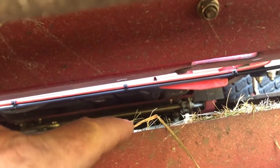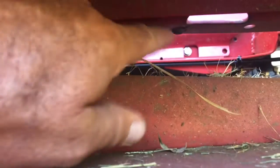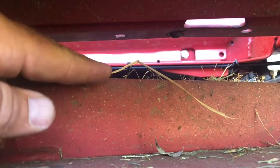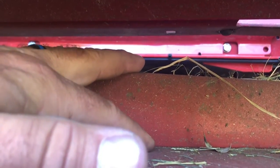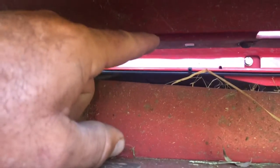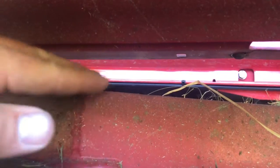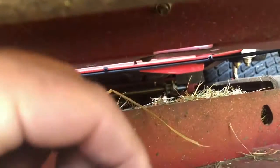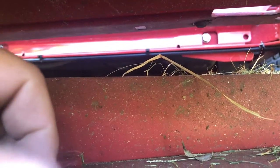This part here is the top of the frame of the deck. As you can see, this is the top of the deck and they have this frame welded around here, and this is the frame of the mower. When this deck goes up and down — right now it's at its highest height, which is carry mode or load mode when you lock it all the way up for the truck — there's only about an inch to an inch and a half from the top of the deck to the frame of the mower. Anytime the deck hits something rough and goes all the way up, it can come in contact with this. That's where the cable was running — zip-tied through this hole and running along the bottom of the frame — and that's what caused the pinch and eventually caused the cable to break.